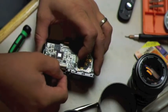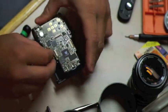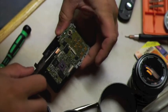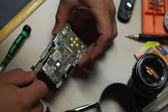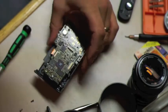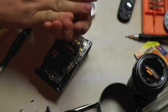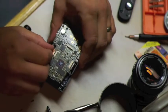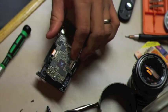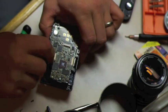Once it gets into the slot you can just push it in from the back — you might need to use the needle nose pliers to push it in. Once that one's in, make sure you lock it down or it will fall out. Then this other one — same thing: take the needle nose pliers, curve it down, stick it in, and push from the back. Make sure the connector is in the slot, because it can be in there but off to the side and it won't work. I had to take my camera apart three times because the LCD, the lens, or something else wouldn't work. So once that's in there, make sure you flip that lock down.